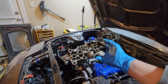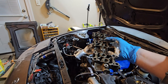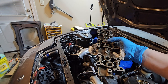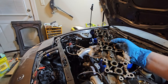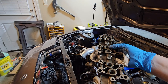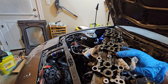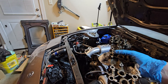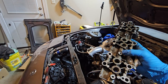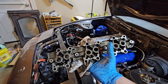It's pretty easy to do, pretty easy to have a machine shop do it. The guy that I had do it made a jig to hold this down. The one thing they need to be mindful of is these bores for your lifters — they are not vertical straight up and down, they are actually off at an angle, and one side sits a little high. So if you deck the whole thing straight across you will deck part of these bores, and you don't want to do that. You need to do one pass down this side, then one pass on the other side, and you also have these center bores here — there are four of them on each side that need to be done. It's not a super hard modification to do.